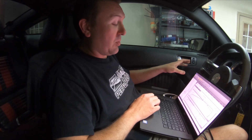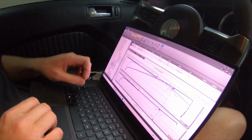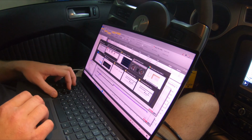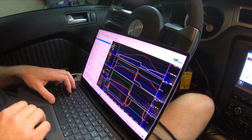I've ran this car up this high before with our older generation supercharger and some different fuel and the smallest pulley we make. We're only on a 2.5 upper right now. We're only on a 163R. This is awesome. But here, let me show you the graph. 782, 742. Definitely a much larger gain. I'm gonna bring up the data log and we're gonna look at that to try and ascertain what went on here.